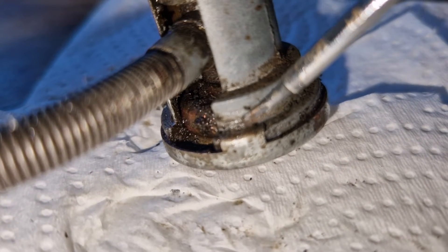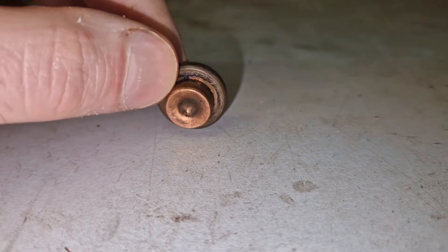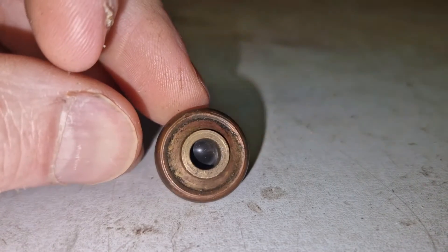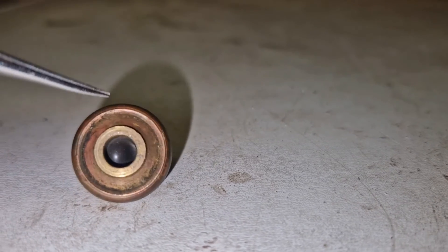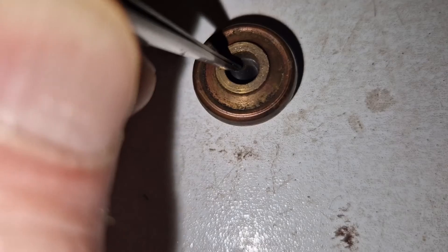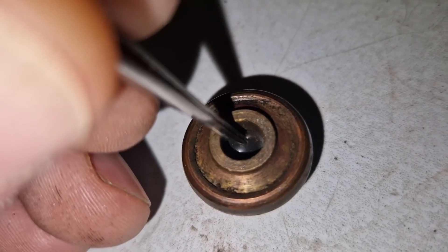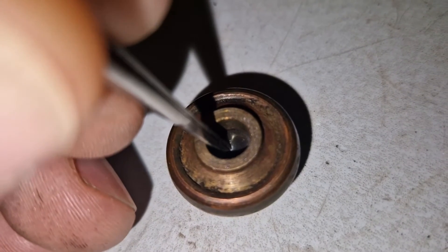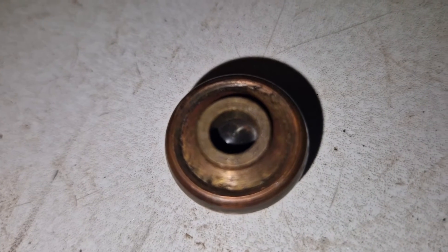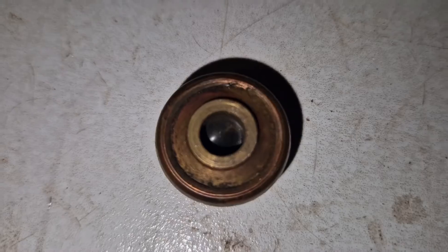Right, we've got the wax stat out. It's basically a copper can and inside you can probably just make out there is some dark gray waxy material. When it gets hot that expands. It did expand a little bit in the end, and I can press on it — but it's supposed to shrink back when cold and expand when hot, and it isn't doing that properly. So this is giving incorrect adjustments to the carburetor when warm, and those are adjustments we don't want anyway since they interfere with the mixture.